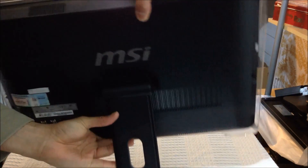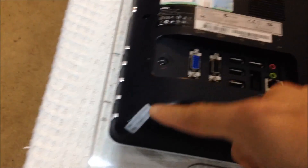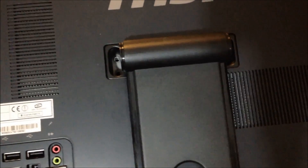To open it up, go to the back — there are screws to remove. Counting them: one, two, three, four, five, six, seven, eight, nine, and ten. There are ten screws in total to take off. Once unscrewed, the side pops up and the little cover for the DVD easily comes off.